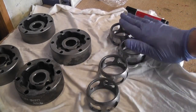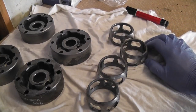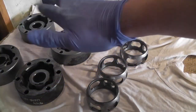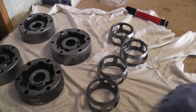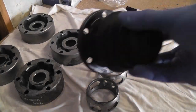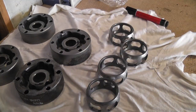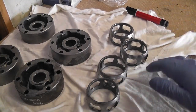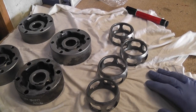Now we're going to have a quick look at the cages and balls, then start fitting them all together. We need a total of 24 balls — six in each CV joint. There's one outer race I'm rejecting because of quite a lot of pitting on it. I'm taking them out into the sunlight since the garage isn't the brightest. There's one ball I'm rejecting straight away — you can see discolouration and pitting on it. I can reject a total of six because I have six more from Trev's joints. When inspecting balls you're looking for deep pitting, scoring, or loss of material.